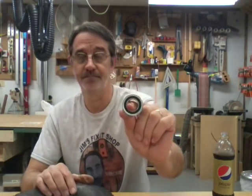And today I've had a few guys call me and say, what's the easiest way to get these bearings out and the new ones in? Well, I'm going to show them. And I'm also going to go one step farther and show you the standard bearings that you can buy. That's what's in here. These actually look a little better quality wise than these things do. Or I'm going to show you a real bearing that you can get and put in these tires. And it's shielded just like regular bearings are.